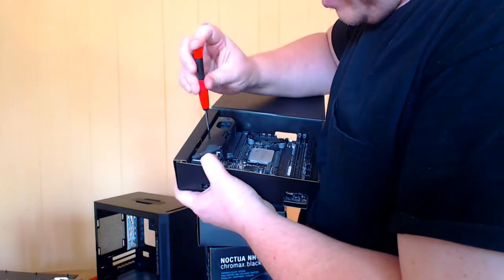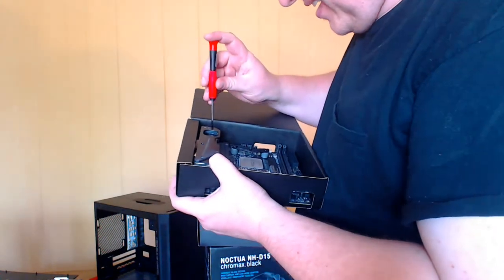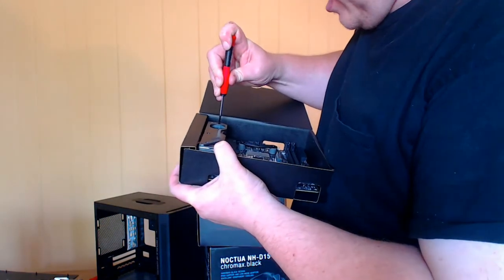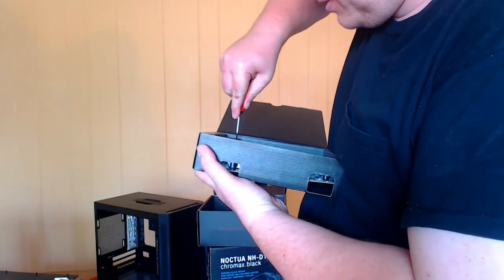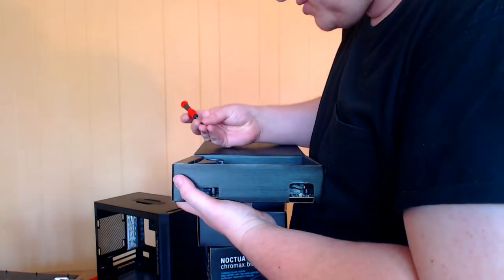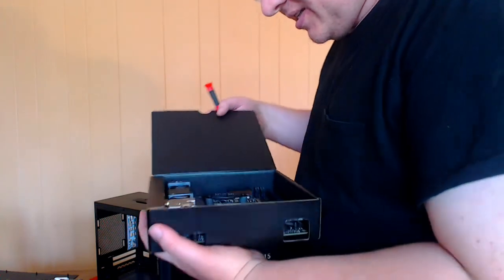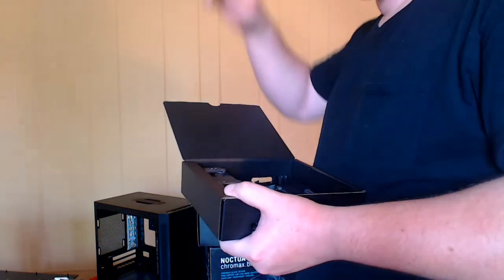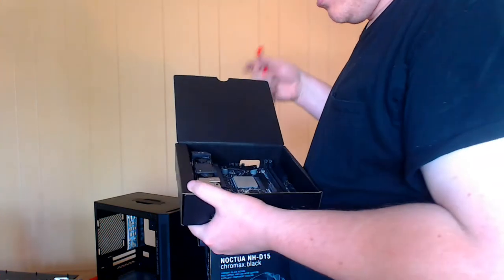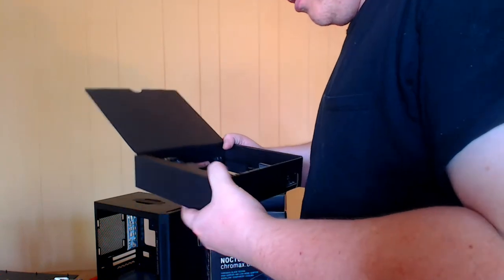You specifically went and got more screwdrivers just for this task. Actually, I did it because your video card was being a pain in my ass regarding getting off. Yeah, we're going to talk about that. He has a 1060 that is having some fan issues where the fan seems to be moving at 100% regardless. I assume that the thermal sensor on it is officially shot because there seems to be nothing wrong with any of the components visually on the board. I haven't had a circuit testing on it done. But, yeah, it's not thermal throttling. It's not having thermal issues. It's running perfectly fine, but the fans are moving at 100%, which is really annoying anytime you do any minor arbitrary task. Indeed.